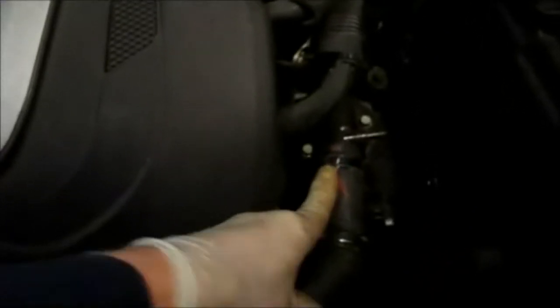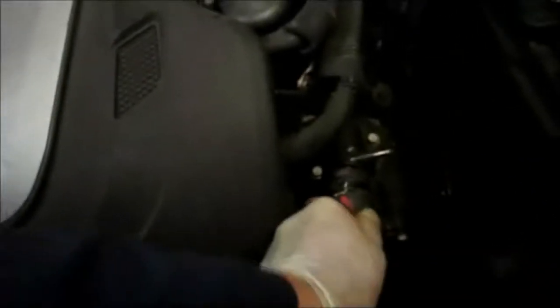I'm also going to remove this upper radiator hose. Pull that clamp back — we drained the cooling system out through the valve on the bottom of the radiator. We drained the antifreeze out and we can remove this hose. Down at the bottom where the hose attaches to the radiator you can't even see the clamp, so they make a special tool you hook onto the clamp and pull it out. Let me get that clamp out, get this hose off, and hopefully we have enough room to slide the fan shroud over and get that alternator out.